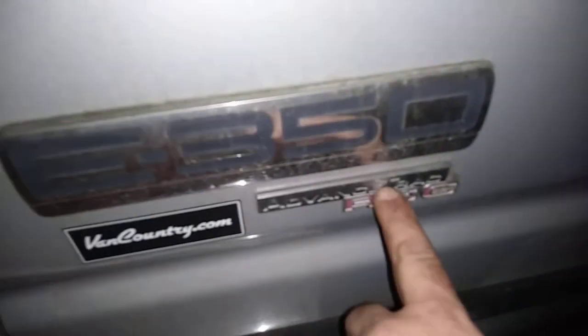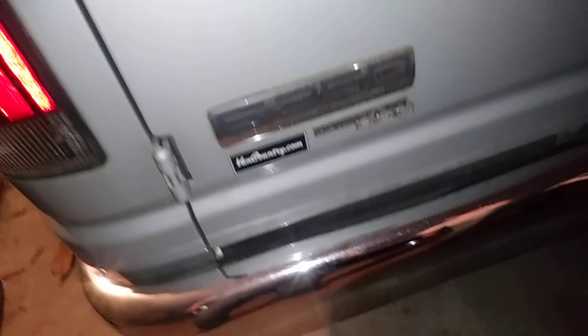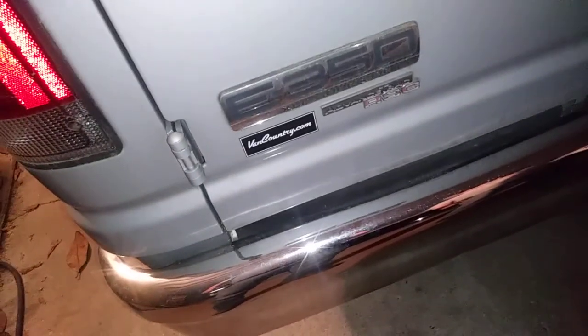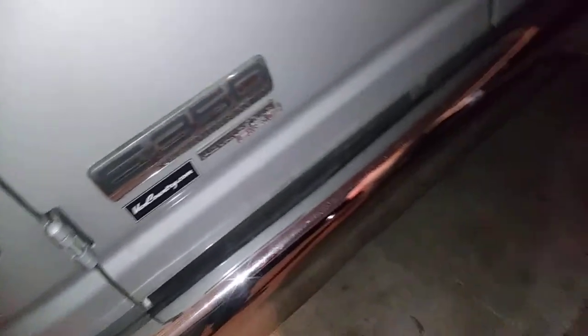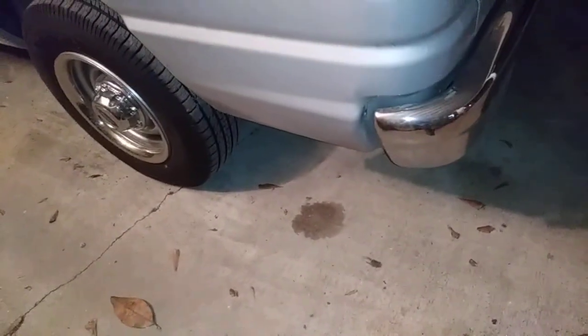And some really wide tires — as soon as we can figure out how to bypass this advanced traction control, which says you can't change the tire size or anything, and it will give you a big problem. But I think we've figured out a way to do that. We're going to take each sensor off and put a neoprene rubber buffer between that and the frame, so it won't detect any wheel size difference, road slippage, or vibration. We'll dampen them, hook them back up — that might be a way of bypassing them, or tricking them rather.